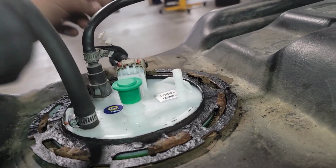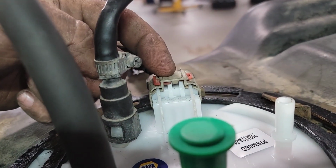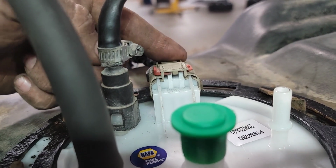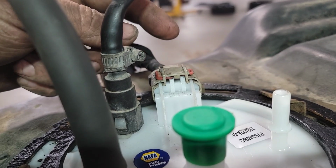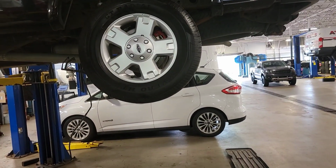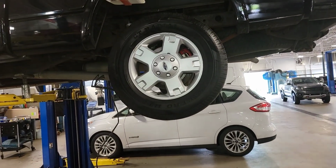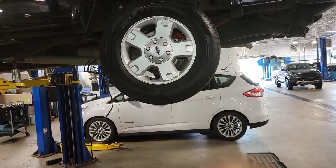I tightened the pins up here a little bit. They had a broken piece of plastic inside here where it snapped. So even though it was pushed in all the way, it wasn't snapped in all the way. So I put that in there, cleaned that out, tightened the pins up, went up inside the connector. We don't have access to that connector, and this guy needs his truck back. So I put the pins back the same way it was, except I closed them in and secured it. And then I sealed up the edges.